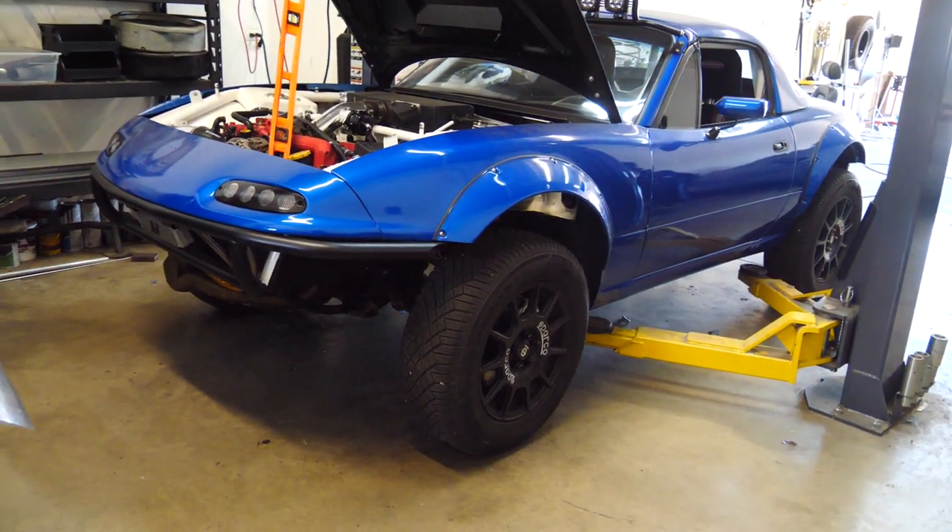If I put a stock spring in it, it's gonna go down an inch and a half. The complications of not having a coilover - the rear I can make whatever height I want, but the front is a stock-style strut and spring, so I can't just adjust a lever. I have to find a different combination of springs and struts. The lift spring has a lot more preload and a higher spring rate at the same size, which is what gives it the lift. I could raise the rear a little bit, but I don't want it to be that tall. I want it to be low, stiff, rallycross.